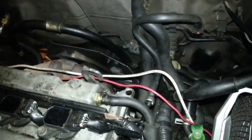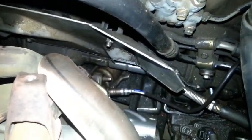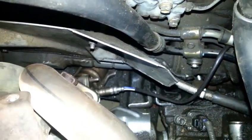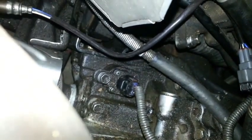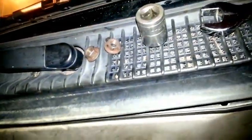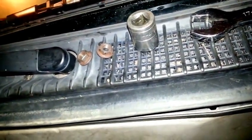I have a good feel for where we're at coming down through here. I took off this exhaust shield — it made things a lot easier, I could see what I was doing. I was able to get a lot more penetrating spray to break up the rust, make things more lubricated. But as you work your way down over here, that's the oxygen sensor that my tool hits — even my shorter tool. I even resorted to using my 17 millimeter at a 45 degree angle that was not taking the socket directly.